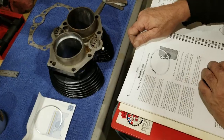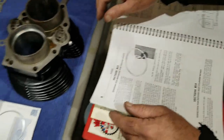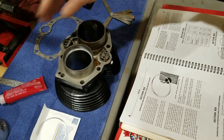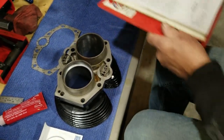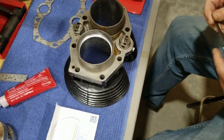All right, so here we go. We got the book. It's saying the compression ring was 10 to 14, and we were at 9. Seems like 9. I didn't try a 10. 11 didn't go. All right, well, let's try that 10 then, I guess. Well, that'd be a tight...